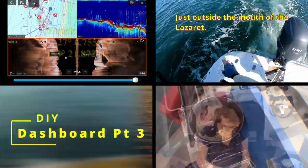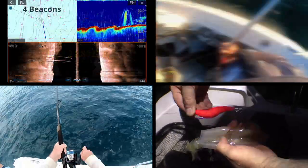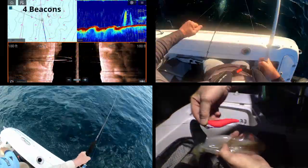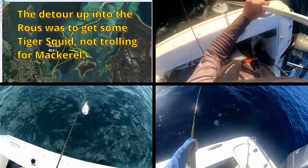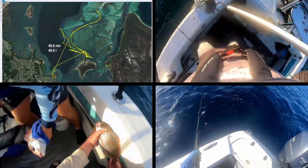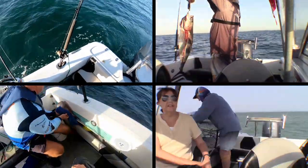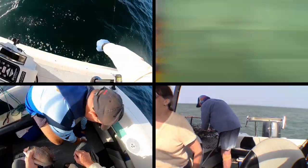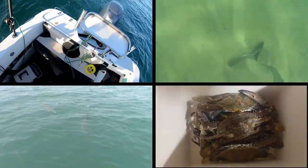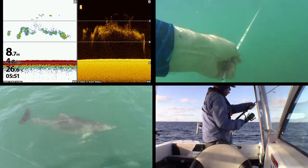You can tell from the video clips that there wasn't much work done on some days. Some days it was just a matter of putting a coat of flow coat on and going away to the next day so it could dry and I could sand it back. Not a lot of work there, just a lot of time - while I'm waiting for bog or resin or flow coat to dry before I can do the next stage.